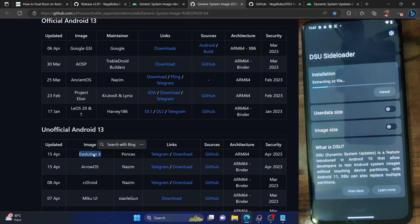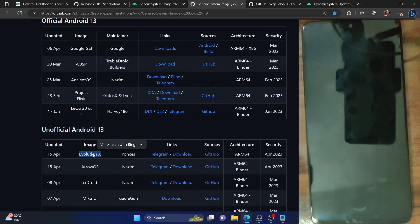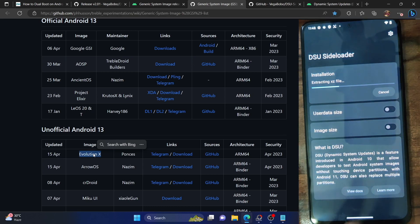Yes, that is a rule — on most Android phones you can only allocate up to a maximum of 40% for the user data partition compared to the overall phone storage size. Verify the overall OS size and then allocate up to a maximum of 40%. The data partitions for the first ROM and second ROM will not conflict. Whatever files are in the first ROM cannot be accessed via the second ROM, and vice versa. Both have separate data partitions. All apps installed in the second ROM will not be present in the first ROM.